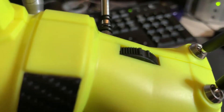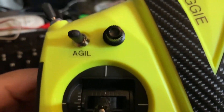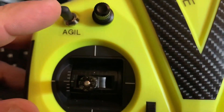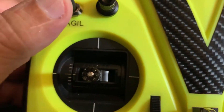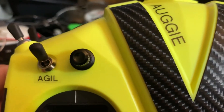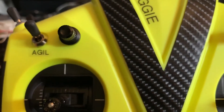I also have this other one here but I don't use it for anything usually because I don't need it for the adjustments that I like to do. And also on this one here, I set it up for head speed, so I can have three head speeds and test the gain of the gyro at different head speeds to see if I like it.